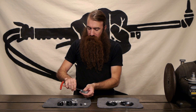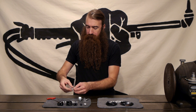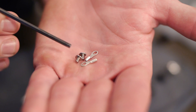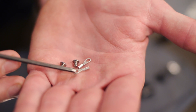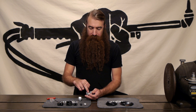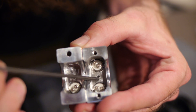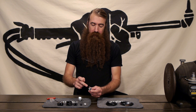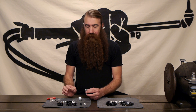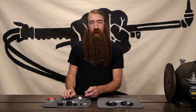Let's take this apart and look at some of the other hardware that comes with it. In this little baggie we get a couple of things: some I-ring terminals and a couple of small screws. Some people don't know what these are for — the intention is to create a ground connection. You add a wire from each switch terminal to one of these little I-ring terminals, then screw that down to the housing. The idea is you have a path to ground through the I-terminal, into the housing, into the handlebars, into the triple clamp, into the bearings, and then into the frame. That's not a very direct path, and I don't like ground paths that wander around that much — it leaves too many opportunities for error and doubt when you're troubleshooting.